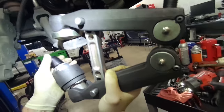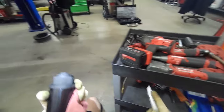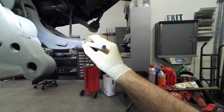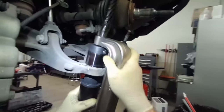This tool is kind of a pain to press ball joints back in — hard to hold and get it started straight. So on this lower control arm, we'll put a small amount of grease on it. There is a grease zerk on these, so I'm going to make a mark. You want the grease zerks to the rear of the vehicle and slightly in, so you don't need to turn the tires to grease them — that's if people do grease them. These probably weren't, and they wore out at a little over 40,000 miles.